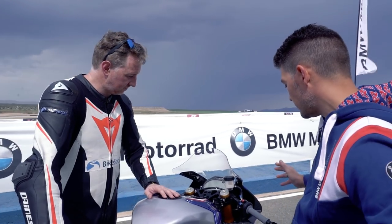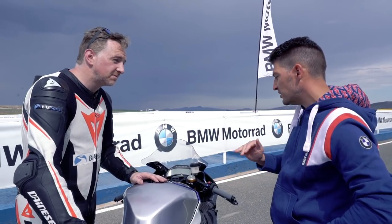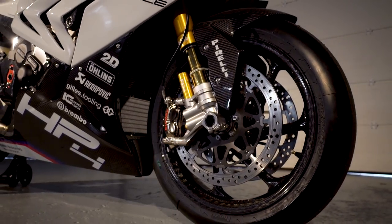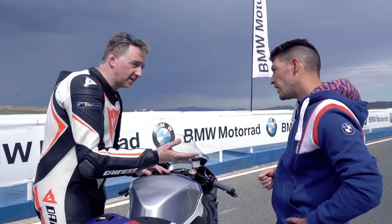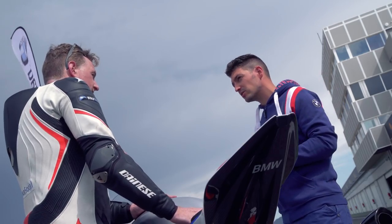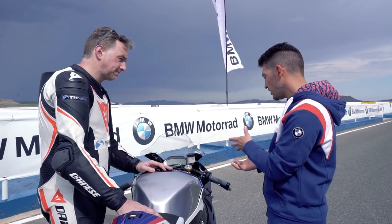100% correct. It looks from 10 meters away like an updated S1000RR, but from the front wheel to the rear it's a completely different bike. The whole package is more or less World Superbike specification: slick tires, FGR 300 forks by Öhlins, and MotoGP rain calipers from Brembo — GP4PR for professional racing. Those are the calipers used in wet conditions with the T-type disc by Brembo. So the front end is like World Superbike or even MotoGP standard.